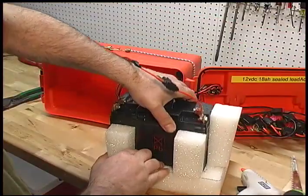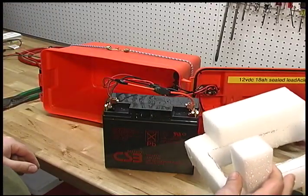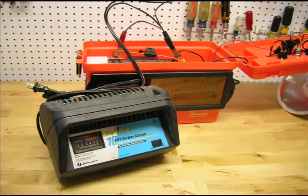Just some final words of safety. If you're using a sealed gel cell battery as recommended, you must never try to charge it with an automotive car charger — you will destroy the battery because it will be overcharged. The gel cell wants to see no more than 13 and a half volts, as it says right on the side of the battery, and automotive chargers push out considerably more energy. Also, gel cell batteries do not want to be quick charged or fast charged — this is a sure way to damage them. Gel cells are happiest when they are slow charged or trickle charged.